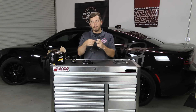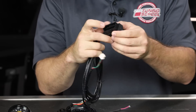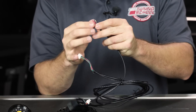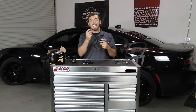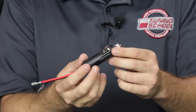The next cable goes from the back of the wideband itself to the OBD2 port. One side of that port plugs into the car and then your HP Tuners unit plugs onto the other side. Lastly, you have your power and ground. On these AEM units it comes with two terminated wires, so you can either wire it into the car, or if you buy from The Tuning School, we include a cigarette lighter adapter that you can attach to these wires for easy transfer between cars.